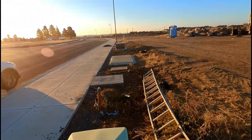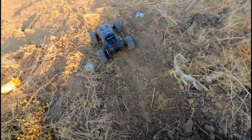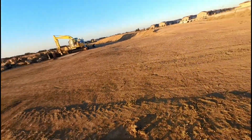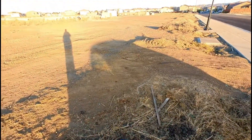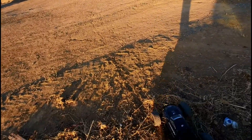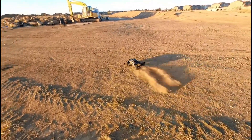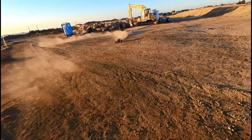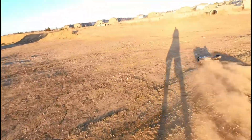We're gonna get this sunrise Sunday bash started up real nice. I had to get the center diff adjusted — I didn't have my gear mesh set properly. With this new aluminum case, this thing is so noisy if you don't have it set properly, but when you get it set properly, oh she sounds so good!